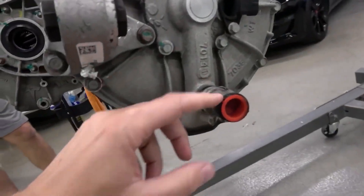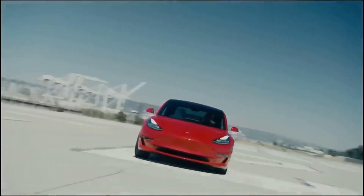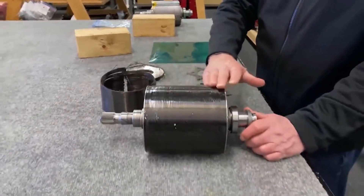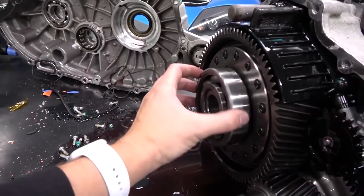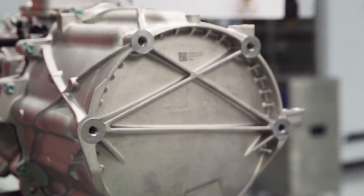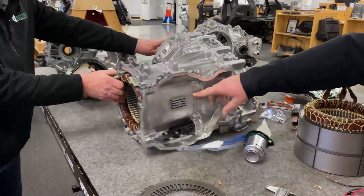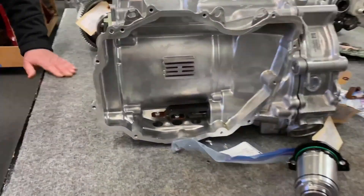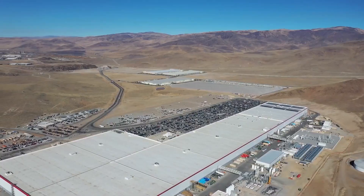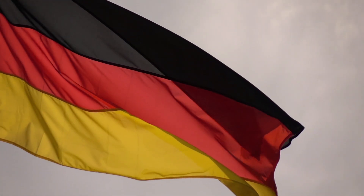What makes this new Plaid motor stand apart is that it's going to be lighter, more compact, and cheaper than other Tesla EV motors. Motors are going to be made of aluminium so that a robust, scalable architecture can be raised, meaning these motors can be used in any Tesla vehicle. The Plaid motor can be easily integrated into several of Tesla's future products. A carbon sleeve is used in the motor and it has to put the copper rotor in compression so that it doesn't loosen at low temperature due to different thermal expansion. A new machine to do this was developed at Tesla Automation. Tesla Grohmann Automation, based in Germany, is witnessing spectacular expansions.